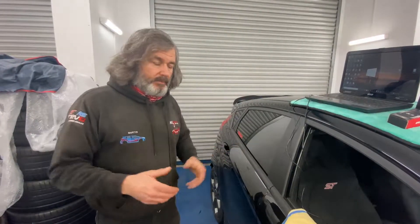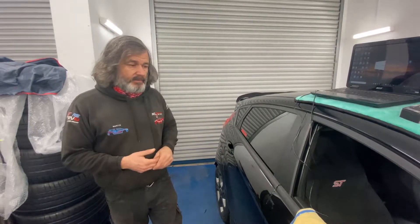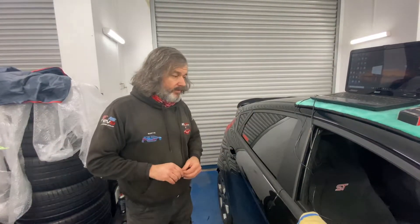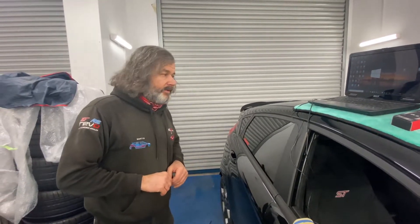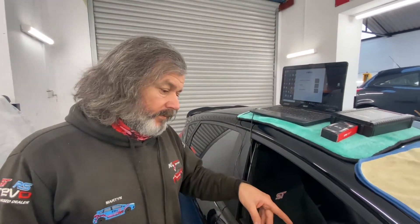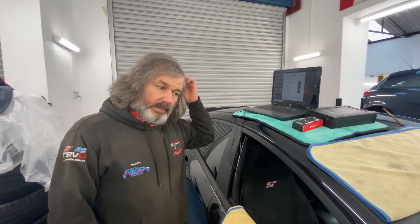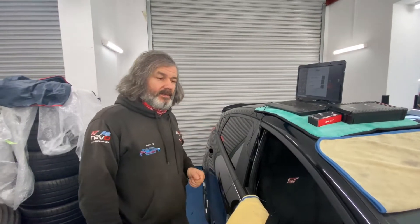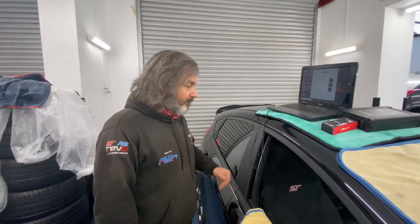So, full service as well. We'll fit the SPS switch, and he's got some Powerflex rear upper isolators that he supplied — he wants us to fit those. We've also got a Mark 8 to do from another Cornwall customer, which we'll explain separately. Let's crack on. Revo software is all installed, Stage One all done, SPS switch checked — all good, works on all functions as it should. There was a bit of a misfire, so we need to plug in diagnostics to see what's going on.